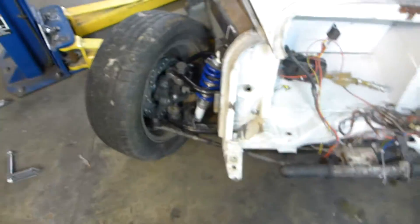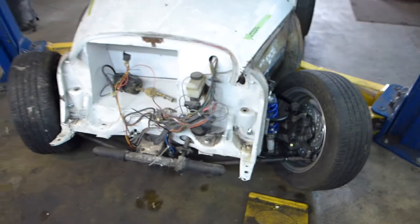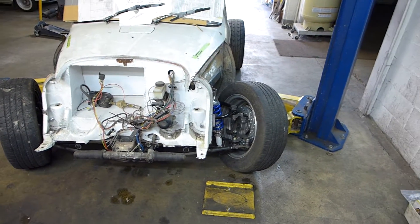So now I've got my Ackerman's angle the way I want it — I'll spin this over to the side. That's full lock to the left if you're sitting in the car, and see how this is quite a bit further out? That's what you want. That's actually a little too much — I've got a little too much caster on that right now.